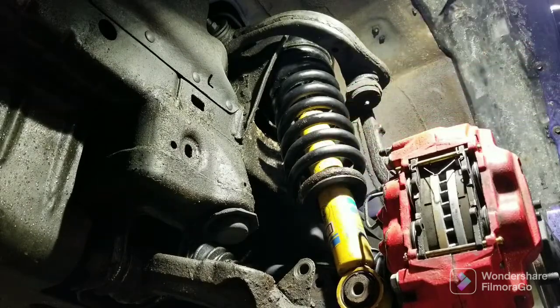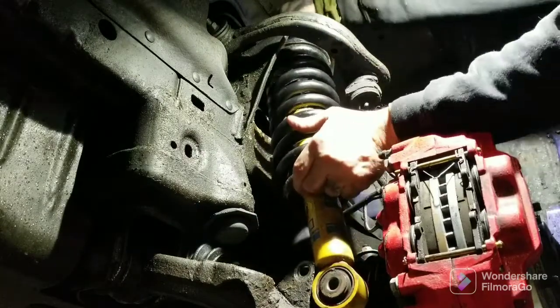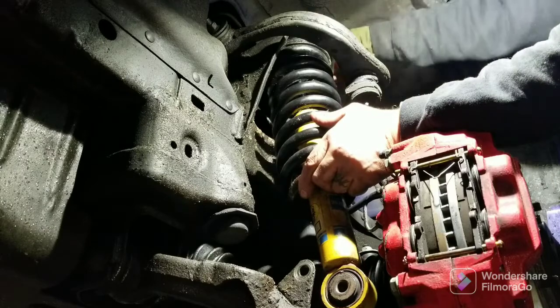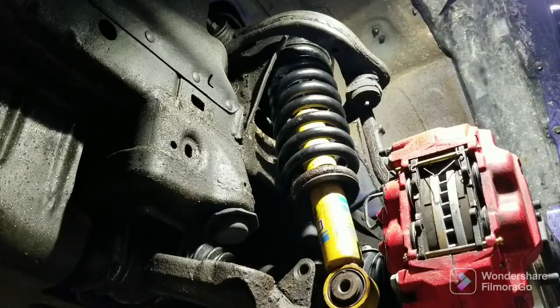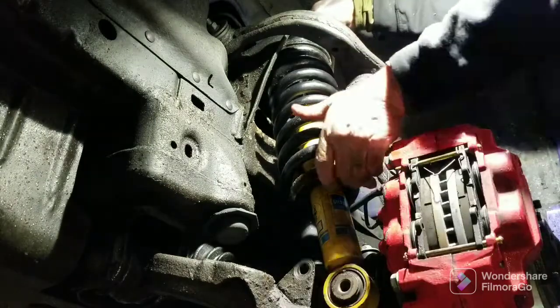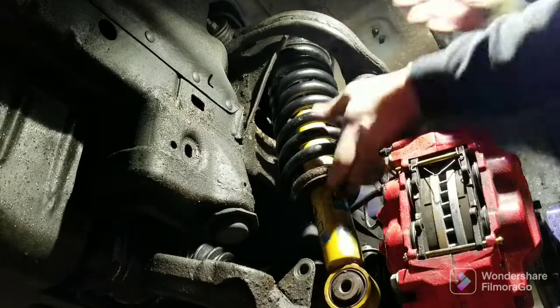That's two. Get this third one. Now I want to run these down enough to help hold this up, but you can see ain't missing too awful much there at the bottom. If you get this too tight in the front, it won't let the strut push back as easy as you would want it to. So let me get a pry bar. Thanks for watching me fumble with that.